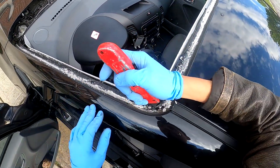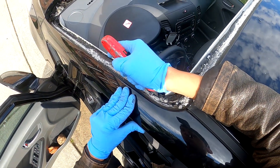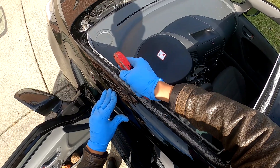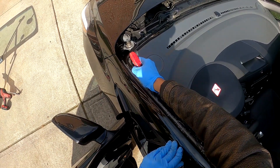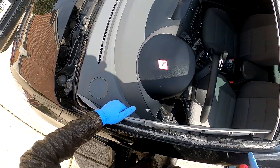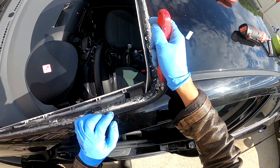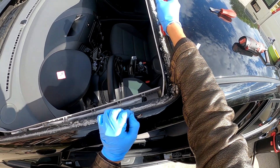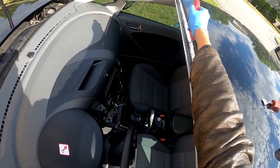I typically like to leave the old USM molding on the vehicle. I'll grab a Stanley knife and trim very close to where the urethane and the USM underlay molding almost meet, leaving a little bit of urethane between them. This ensures that when the glass is set it will look a lot more aligned with the old USM molding — it just looks a whole lot better. Also go ahead and move the A-pillar cover out of the way with a little push of the wrist; you don't need to take them all the way off, just loosen them from the main clips.